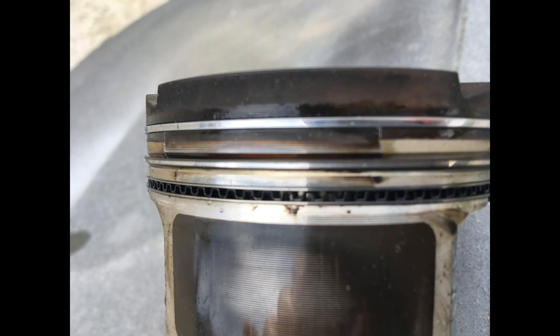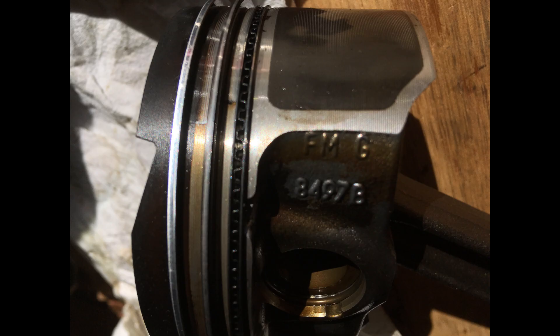This is a picture of piston number three. Note that there are four cracks along the ring lands underneath the first two rings. This was probably due to severe detonation that occurred at the track — I had received a code for severe detonation after tracking the car.